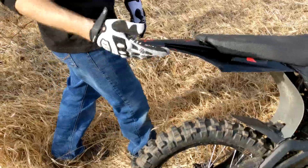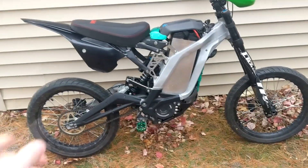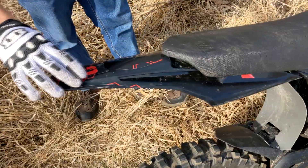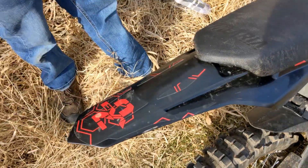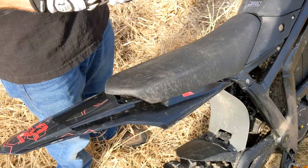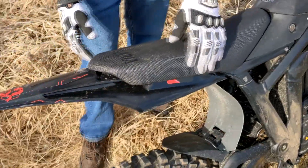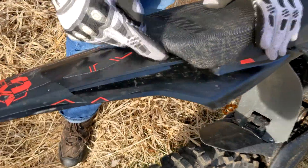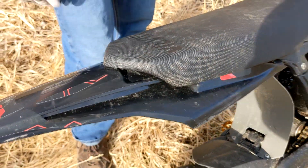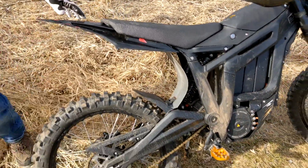Last up — I made a video about this rear fender quite a while ago when we tried to put it on the Suran. It's basically a motocross-style fender with big number plates. I did have to modify it a little bit to get it to fit — the rear two bolts that come down onto the seat required drilling, but it took about five minutes. It fits on there perfectly and hugs the seat really well.